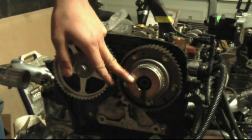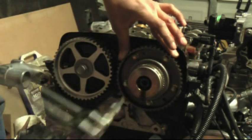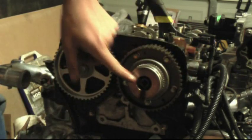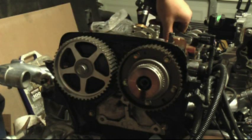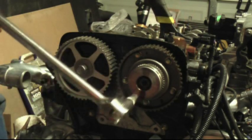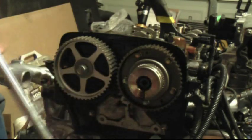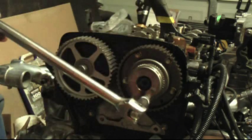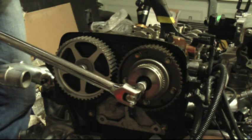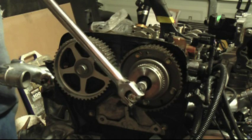And once you have the front seal cover off the pulley, the actual bolt that holds the pulley to the camshaft is this Allen bolt right here inside. It's a 10mm. Again, same thing. Hold onto the section on the camshaft with the adjustable wrench and a 10mm socket, or an Allen wrench is fine, but you will have to add an extension on that because this bolt is held in pretty tight, so you need a good bit of torque. And keep in mind this pulley will move because of the VVTi.